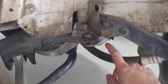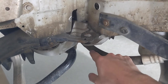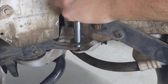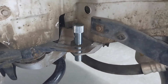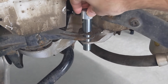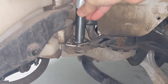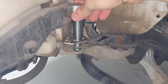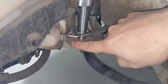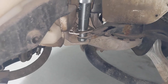Keep in mind, the entire goal is to match up with the master hole — the one attached to the chassis, the one that can't move. Let's see how I did lining up the motor mount bracket and the subframe. Oh, look at that — that's great. There's a little bit of play, but it's equal throughout each of the holes. That's damn near perfect. And how about the driver's side? No, that's not happening. I can tell that the subframe is a little bit forward towards the front of the car, and the motor mount bracket is not even close. On to the alignment.